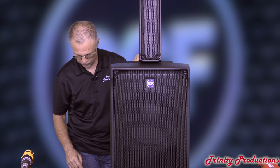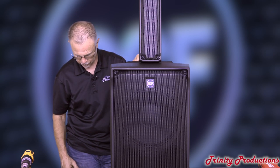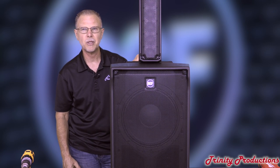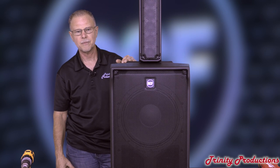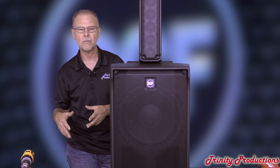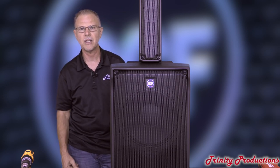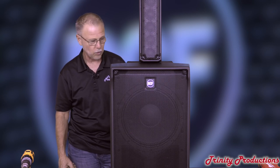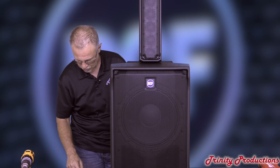Continuing up: 1k, 2k, 5k, 10k, 12k, and 20k. So it will do all the way down to 40 Hz — it's just going to be a few dB down. The thing with that is, even though this is a low frequency quote-unquote subwoofer box, you do risk over-excursion on the 12-inch driver if you drive it hard at those very low frequencies. It's got a lot of power behind it with this RCF amp, but it'll do it — that is pretty amazing.